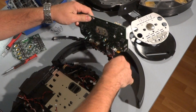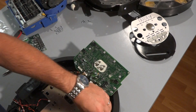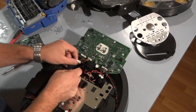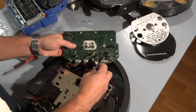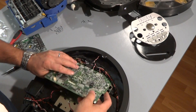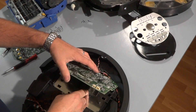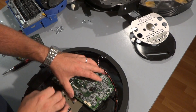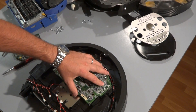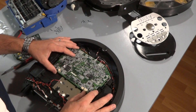Now I'm going to put the IR line array back in place. This is the same line array used in the 500 and 600 series, in case you're wondering. Go ahead and plug everything back in to the PC board. Again, make sure you're not pushing any wires down over the holes where the screws might go, so when the cover goes on it doesn't press down and pinch the wires. Line up the springs from the side brush motor right over the holes and make sure everything else is lined up.